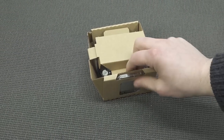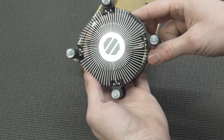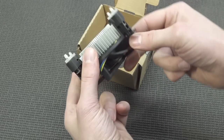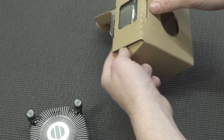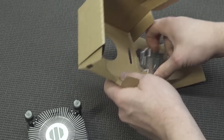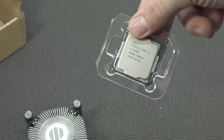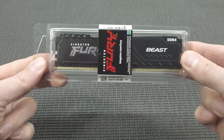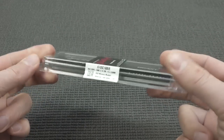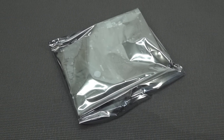Okay, so what we're going to use is the i5 9th generation, or better called the 9400F. This thing doesn't come with a GPU installed inside the chip itself, so we need to have a separate GPU. Take consideration, if you're going to build a mini PC purely for emulation, you don't want to use a dedicated graphics card, you need to get yourself a CPU with a graphics chip inside. Something you need to take consideration. But okay, this chip itself is quite a powerful one. It's not maybe the latest i5, but for the purpose I wanted to use it, it's more than enough. And also I just like to see how far we can push this device, because this chip was on sale here, including everything else. So I think it's going to be a pretty damn awesome kit, basically for emulation.